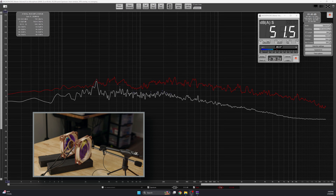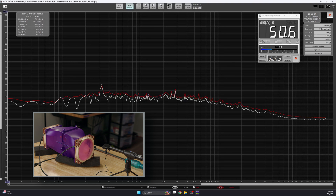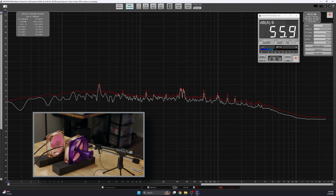In the noise test, the Dual Blower came in around 55.1 dBA, the Solar came in around 51.6, the Flow came in around 50.8, and the 11 Wings came in around 56.8. This actually surprised me because I imagined the Dual Blower to be the quietest given how big those rotors were and how slowly they'd spin. But the Flow was crazy quiet — and it didn't just measure quiet, it sounded quiet in a pleasant way, not harsh on the ears at all.